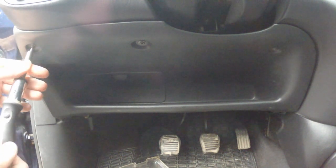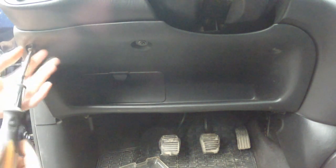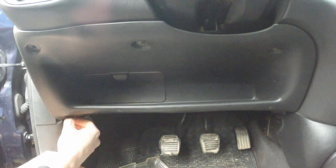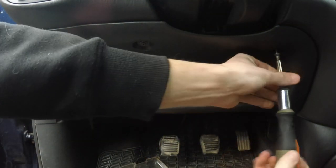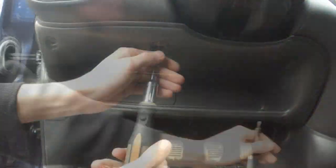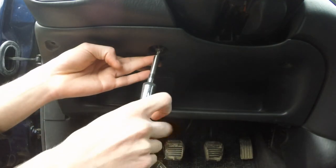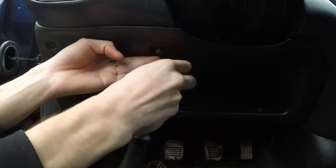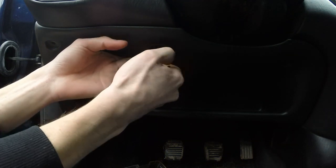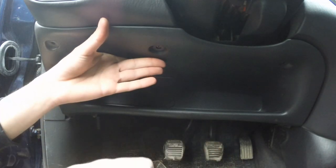Just remove that piece of plastic from the underside of the dash that is held in by these five screws. Make sure you put the screws in a good location so you don't lose them. I left the middle top one in just so I have an easier job. After you remove the middle top one, the plastic piece is only held in by one clip. Now you can pull it out, but gently — make sure you don't damage any of the wires leading to the OBD2 port.